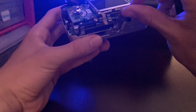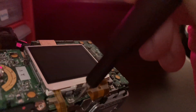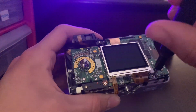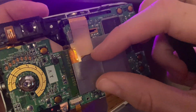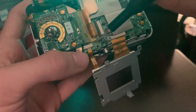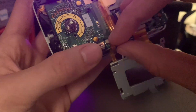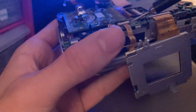Starting off, I'm not really sure what I'm doing — I'm kind of figuring this out as I go. But you can see the LCD is lifting up, and it's tied down with two ribbon cables that are easily removed. To get that off you have to unscrew the bottom two brackets that are holding it down. There's a little hinge on the top that can be taken off, and some tape that held down the other little connector for the controller. There is a little plastic piece that pulls out of there that loosens the fit for the ribbon cable, so as soon as that's out you can easily pull out the ribbon cable.